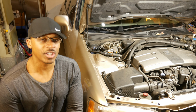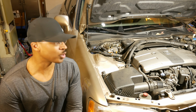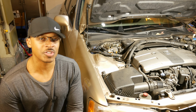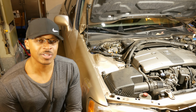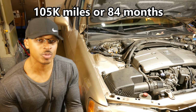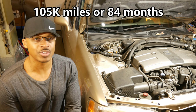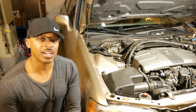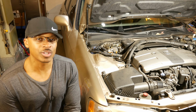But what we're going to do today is take a look at the spark plugs. I don't suspect we need to replace the spark plugs at all because I've only got about 40,000 miles on them. But I would like to at least take a look at them. And so during this video, you'll be able to see how you would replace the spark plugs on the Acura RL. So the typical recommendation for replacing spark plugs is 105,000 miles or 84 months, whichever comes soonest. I am nowhere near that, obviously, at around 3 years and about 40,000 miles. So we're going to go ahead and take a look at the spark plugs, but at the same time, I'm going to show you some things I look at when I'm looking at spark plugs on my car. So let's jump into it.